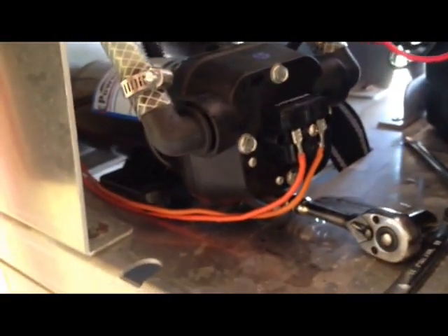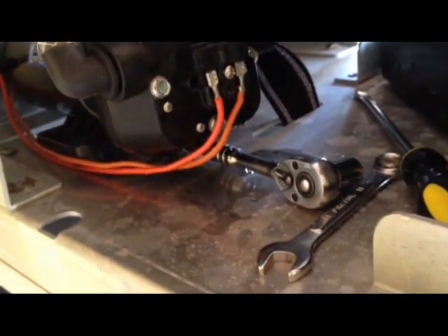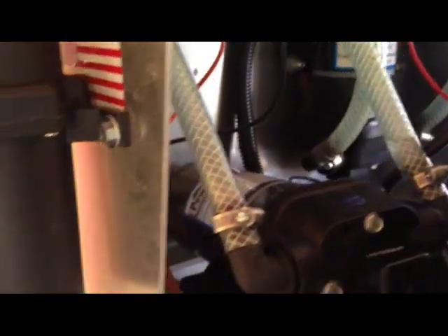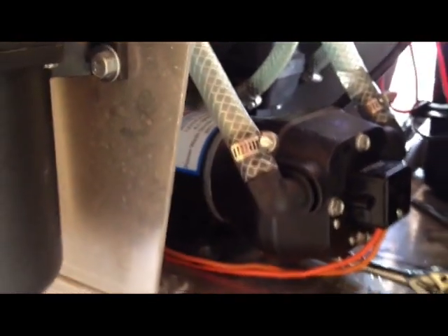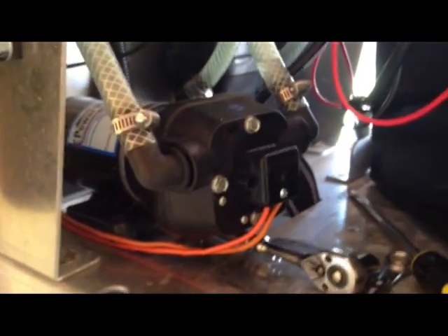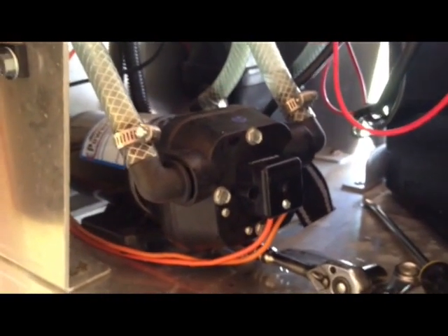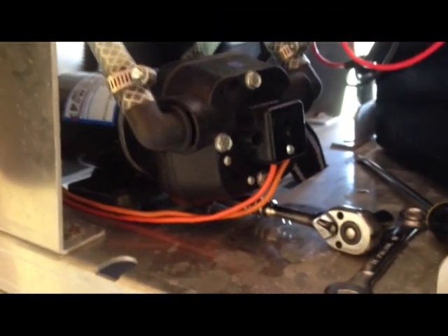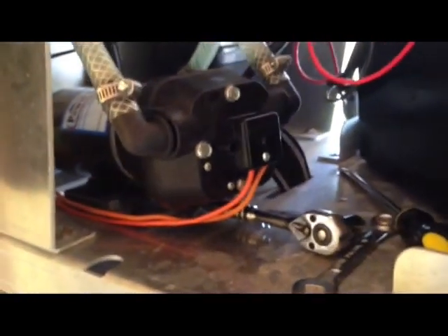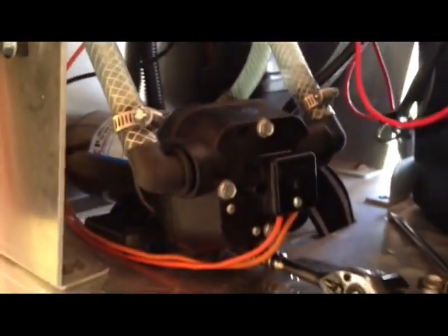So that's it. We'll screw this head back on, pump goes back up, four holes in the back there, everything in order. Hope you have learned something today. For those who have purchased this system, I hope this video can be used to help you troubleshoot — especially if you want to stay on a job. Everything went fine with mine; it was the pressure switch. I would also keep a spare pump just in case. If you shut down on a job, don't think that it's all over — it could just be the pressure switch. Over and out.